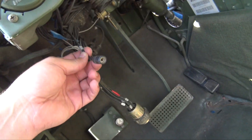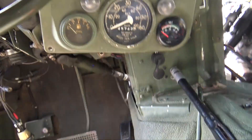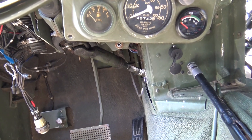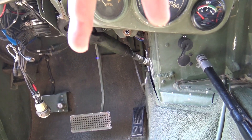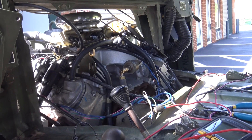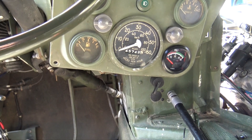Here's where I am today — I took a loss. I found the right wire for 24 volts, which is 27F. It works the windshield wipers and everything, and it even gives the gauges their 24 volts, but all the gauges just peg straight to max. I think the temp sensor is wrong — they put the wrong one on the motor. The fuel tank sensor plug I think is switched in the wrong direction. Oil pressure I don't know — we used the factory oil pressure sensor off the diesel. We're going to get a new one, take the tank down, do some work. Today was a learning day but not a winning day.